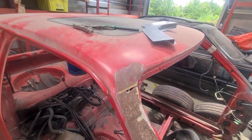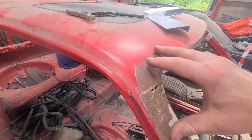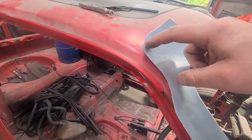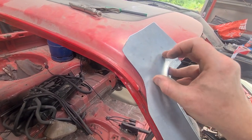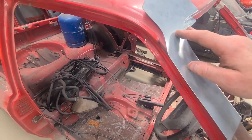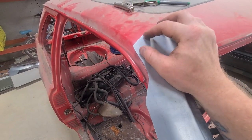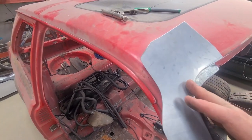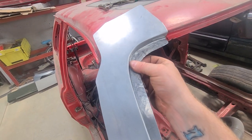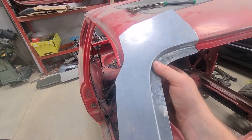So while I was clearing up, I actually had to think about this quite a lot. I said about getting the beater bag out, but I don't really want to be stretching it. So what I'm going to do is take it over to the shrinker stretcher and shrink this bit first, or that area first, I think. It will still need to go on the beater bag and sort of shape in and everything else, but I reckon if we can get this tucked in first, then we're going to have a decent start of it. I mean, you can see how nicely that just fits in there. Shut the marks. Bosh. So my buck worked perfectly.